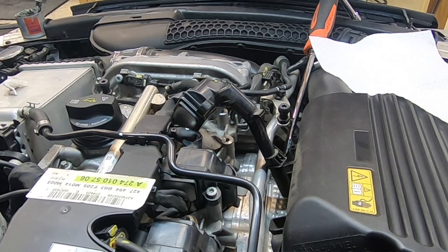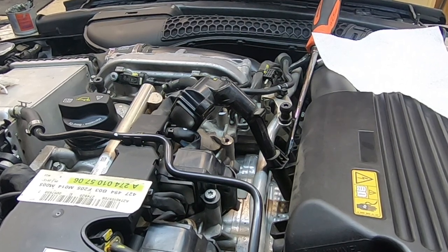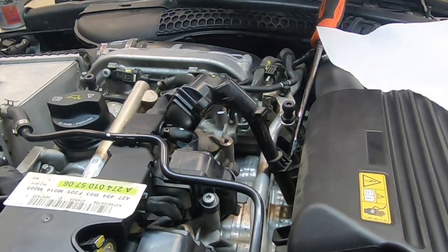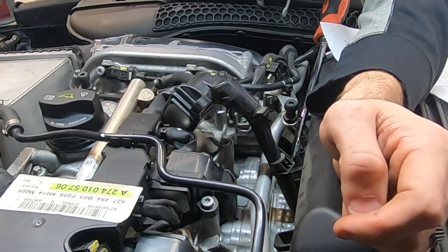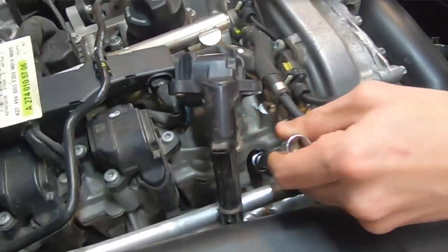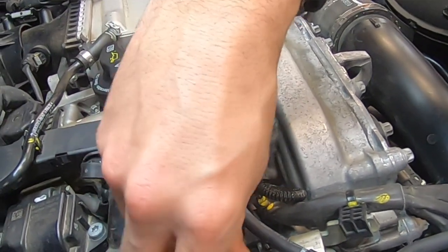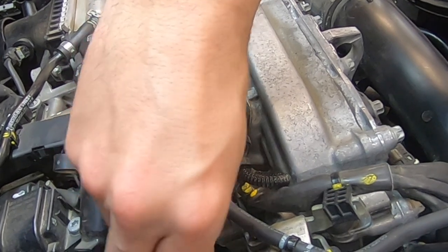The space in the head is not big enough for the paper towel to squeeze down beside the socket, so the paper towel has to be 100% inside the socket for it to work. There's only enough room for the socket itself. Put the paper towel inside the socket to hold the spark plug, then lower it down into the hole slowly and carefully. When installing the spark plug, be careful not to bang the end of the plug against anything — you could close your gap.